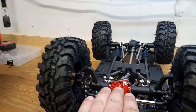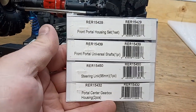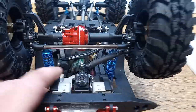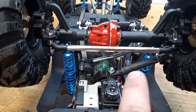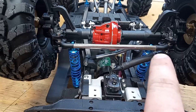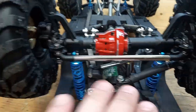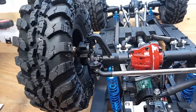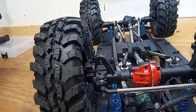This is all the stuff you'll need — you can pause on it — to make the whole front axle work. The center link I had to make custom, it's really short. If you run the factory front member you can probably get away with the one they provide. The key thing is: the axle housings themselves will not work together. If you're trying to save money, the old axle will not work with the new setup — you're better off throwing the old axle housing in the trash.